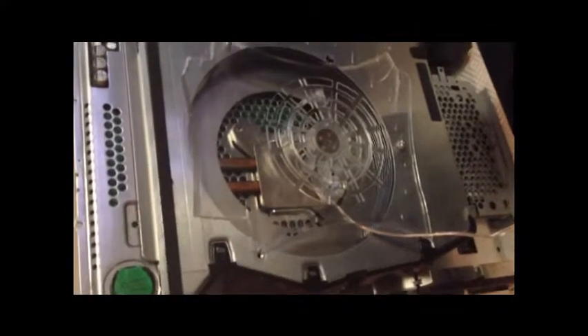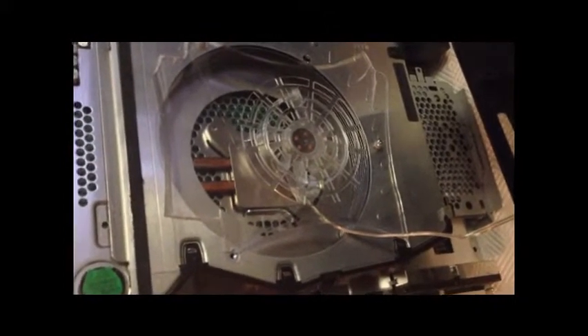The fan goes into the little hole or port where the original fan went. It's not as powerful as the original fan, but it does seem to keep it cool and run okay. I don't know whether it will run for hours or stop working after two or three hours, but I've switched it on and off maybe five or six times, run it for 10 to 15 minutes, and it seems to run okay. In order to create a port for the USB to connect to the PlayStation USB port, I also had to change the front of the PlayStation 3 where the four USB slots are, merging two of those slots to create a big enough opening for the USB cable to route from the inside of the PlayStation all the way to the outside.